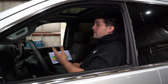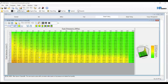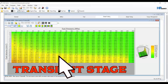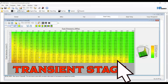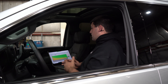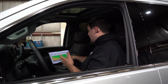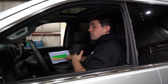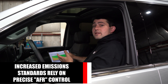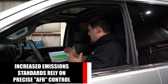A lot of people will say, oh, I'm running 2,600 µs — how much fuel are you running? Well, 2,600 µs is only your maximum amount of fuel. That doesn't tell you how much we're putting in during the transient stage and the part-throttle stage. That's where the drivability really gets dialed in. So after we've determined our pulse width, we've got to get it to the truck. That's not as simple as putting a number in the bottom corner and saying the truck's going to make more power — we're putting more fuel in there, but there are other factors that come into it. We have lambda control, which we'll get into a bit later, and that's the air-fuel ratio mixture the truck's going to allow, and we can also optimize that.